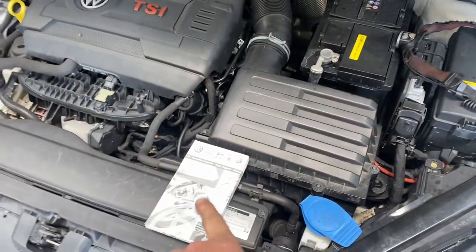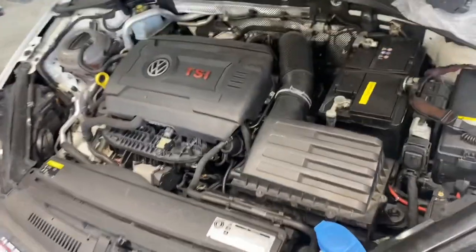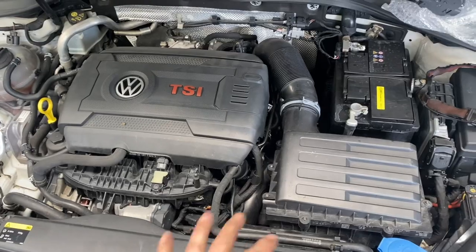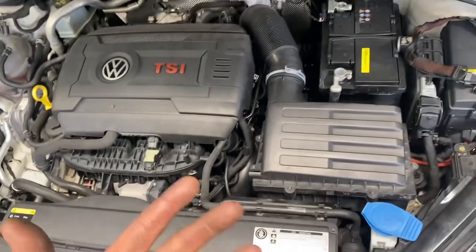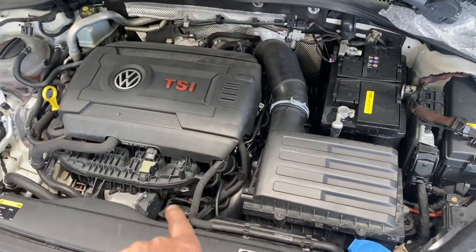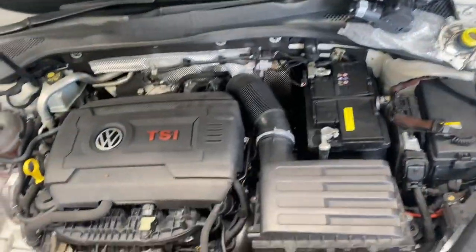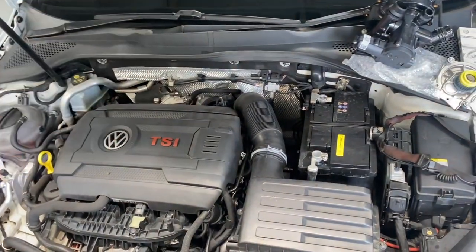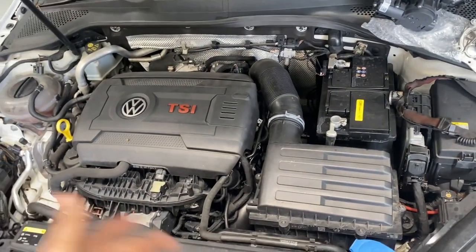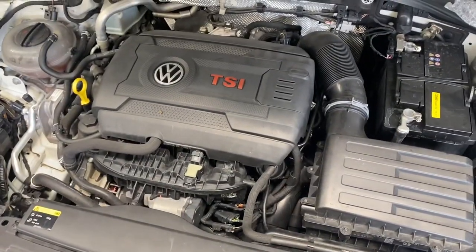Hopefully down here with potentially a belt on it. Dave did say this is very hard to change, so I don't know whether we'll do that or not. My attack plan is I'm probably going to take off the intake manifold and try to see where I go from there. At this point it's very hard to see from either the top or the bottom. Hopefully this will be a good tutorial for someone — these pumps are on a lot of the newer Volkswagens, driven by this shaft and belt.